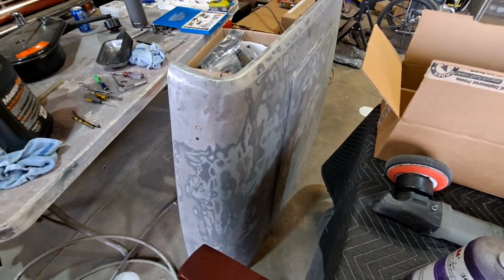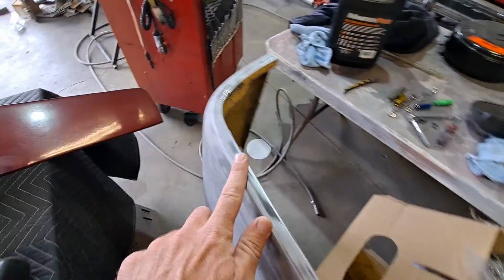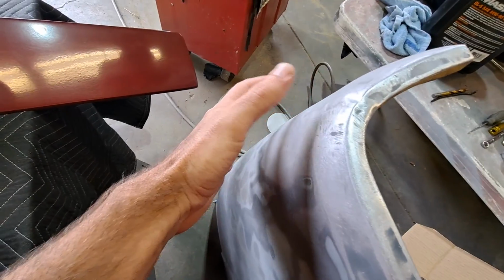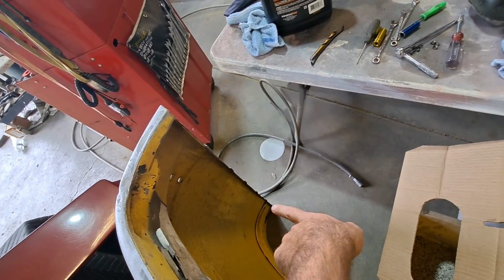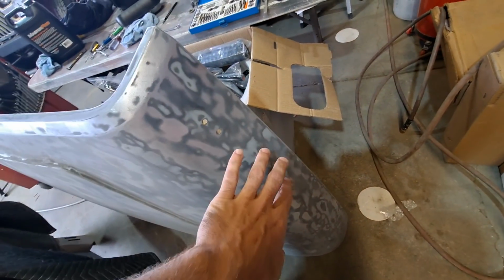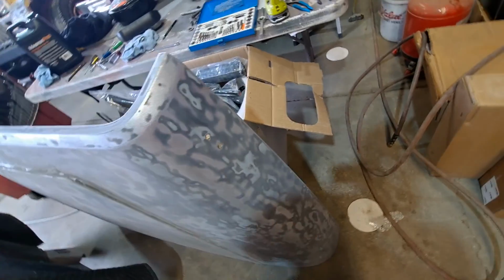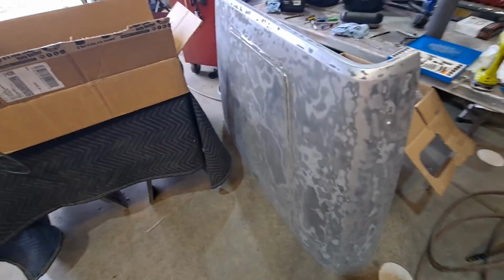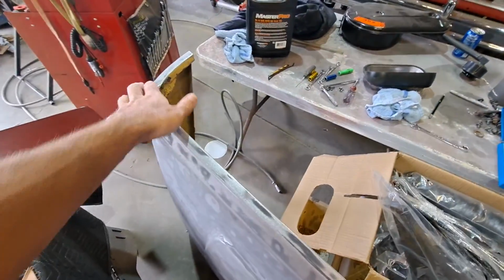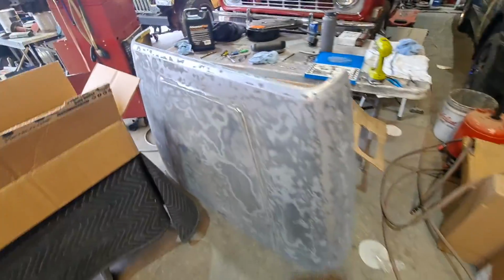But as you can see, nothing really survived on that hood. And then I mentioned it had been in a front end collision. Well, the front edge of the hood is really beat up and it was full of mud, and there's a big body repair right here. And these edges down the hood were folded and walked, and then the side of here and the side over here had filler because it was pooched out from it being folded. So I had it on the bench earlier and did the metal work on it. So it's all metal prepped now except for this one corner. I'm going to work on it in the morning. We'll throw it back up and put some mud on there, and it should be ready for primer.